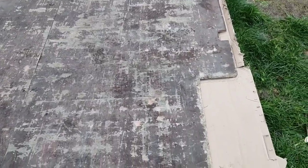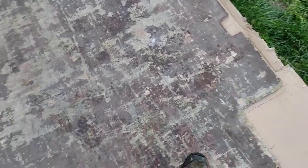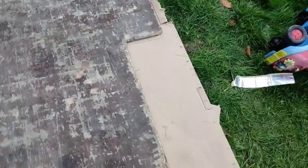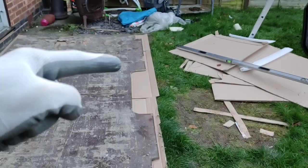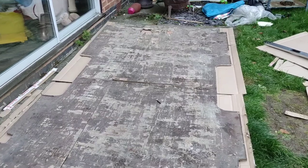That's okay for us because we've got a track saw so we can easily and accurately do that. But if I was doing the floor again I'd have put timber battens in the floor at 1220mm from the front edge and worked my way back from there. It's taken quite a bit of effort to cut these to size and then line them up with where they're going to end up in the van — taking measurements off this line to the edge and off this line to the edge, and then at the back from the rear of the wheel arch back. We've traced around it with a sharpie and now I'm going to cut it out with a Stanley knife, then check it in the van and modify the templates if we need to.